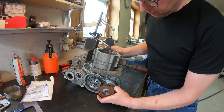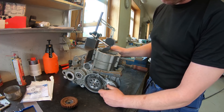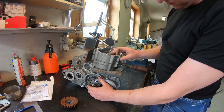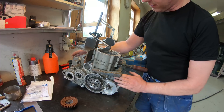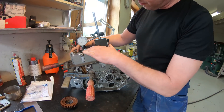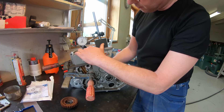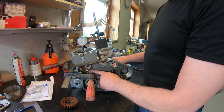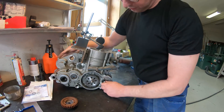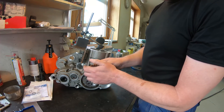The next step is to find how both gears can be synced together so that the counterbalancer will move in a proper way according to the crankshaft. In order to do that I need to find the top dead center for the crankshaft. I'm using a not-so-super-accurate method but it works well enough for this task — a dial gauge to find where the crank is at its top. I put some pressure through the crank so it won't move during the process, then do the same with the counterbalancer, and finally drill the holes and make the threads in the hub.